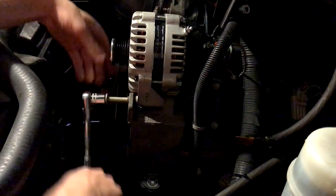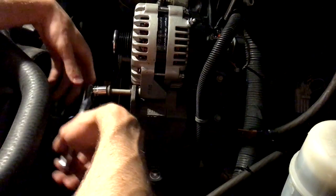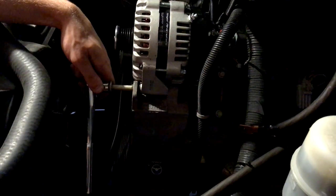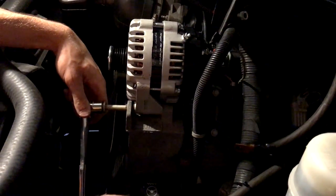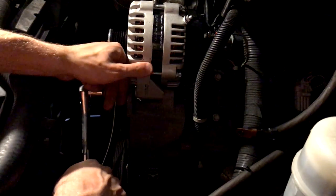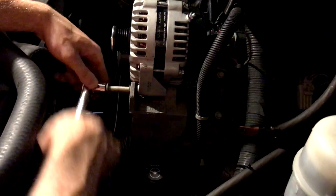We got her in here — she's sitting right there. We had to give her a couple taps to get it to fit in with the bushings. If you do have to move the bushings, I recommend getting a small ball-peen hammer and tapping on them to loosen them up. The looser they are, the easier it's going to be to put them in. In our case it was easier to tap on the alternator itself, which left a couple small marks — but it's under the hood and no one ever sees it.